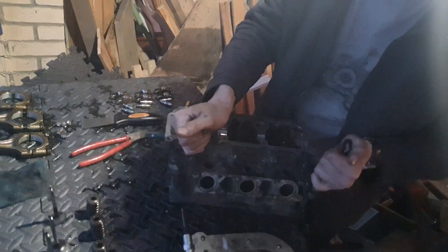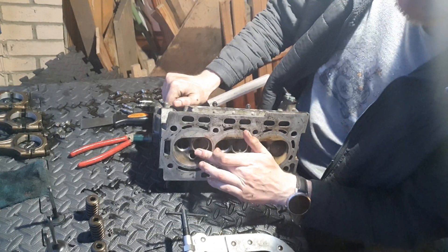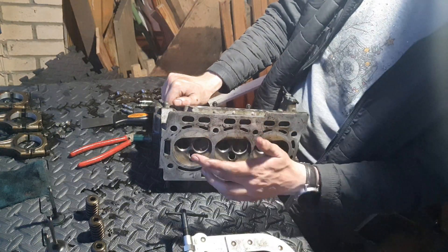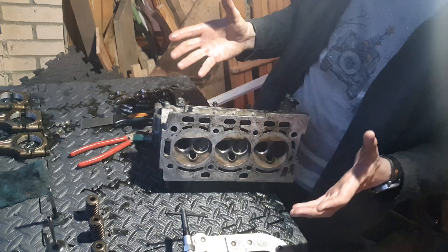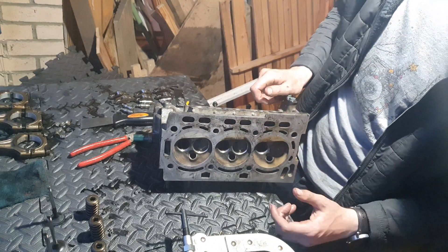Sometimes when rebuilding, what they'll do is cut a new face onto where the valve actually seats. They may bore them out, and they may do what's called porting — that's porting the intake and exhaust ports for better flow, smoother flow, getting rid of rough edges, everything like that.